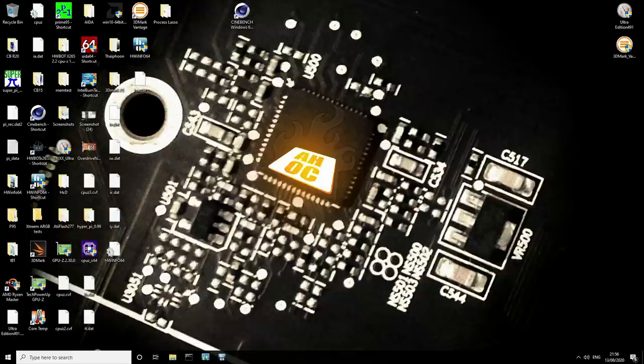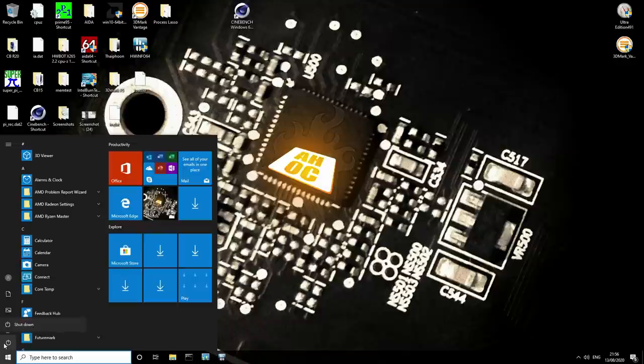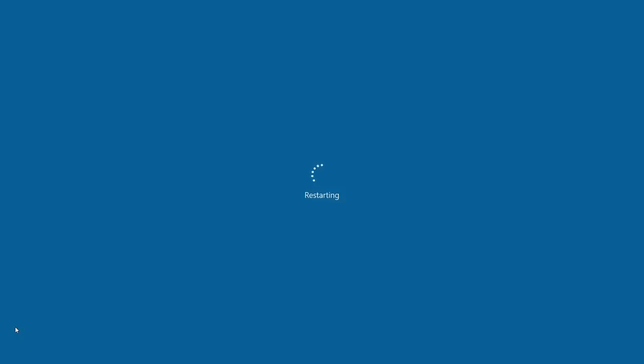If I had a bit more cooling, I'd bump up the voltage a bit, but for right now, the thing is, at stock it was running up to like 1.26 volts in Prime 95, and right now we're at like 1.25. But at the same time, I'm also running hotter than at stock. Well, not stock, but with the PBO settings, I'm running hotter than the PBO settings.